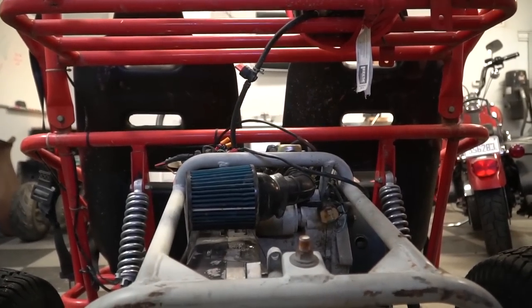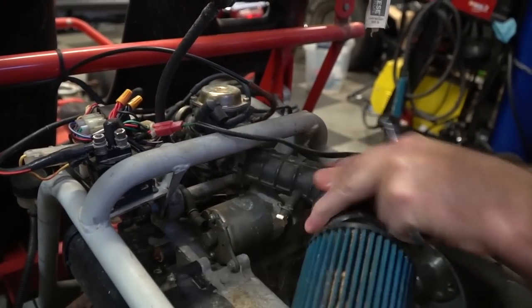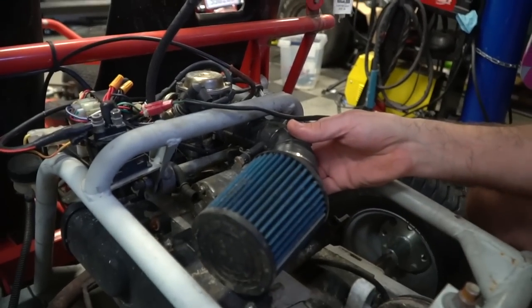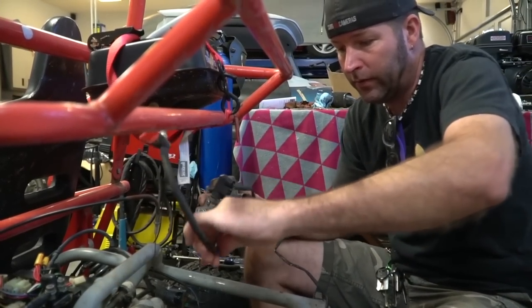So it has either a float that's sinking or sticking, or a needle valve with a bad tip. We've been meaning to look into performance upgrades for this 150, but we've been so busy getting ready for the event. This is the first full day we've been back. I've been wanting to look into performance mods for this engine because, dude, it's a beast right now. We have one Phillips screw on the intake arm. It got a little dirty but wasn't too bad — the positioning was pretty good.